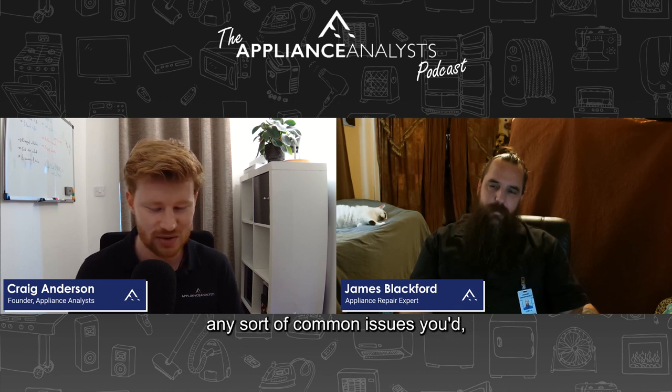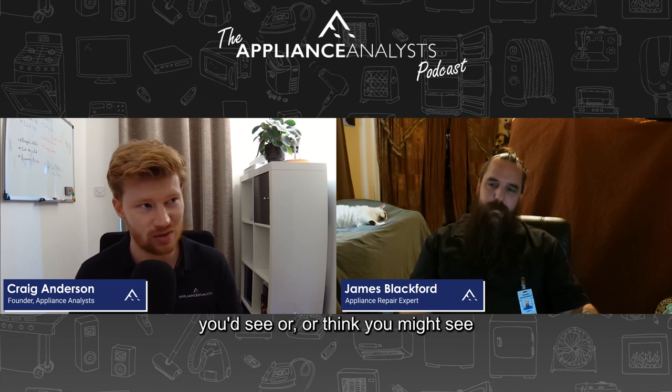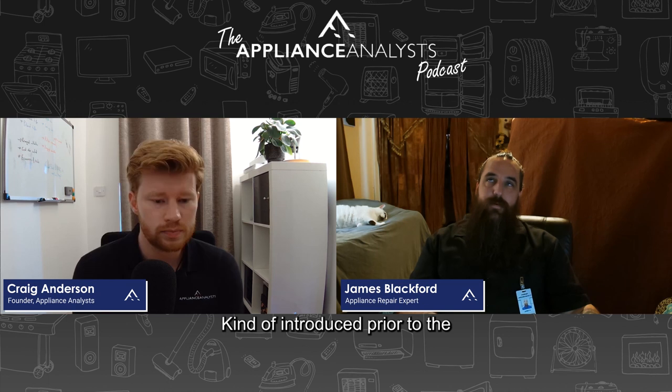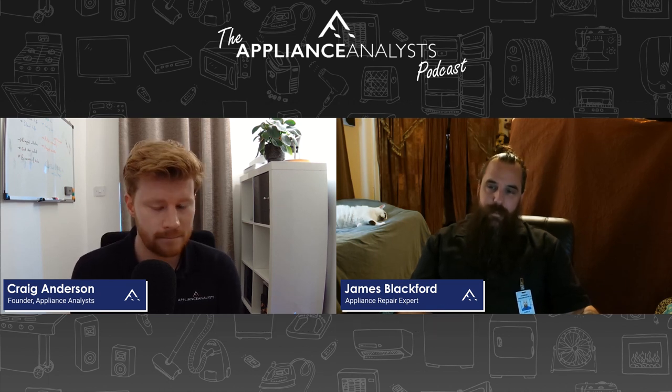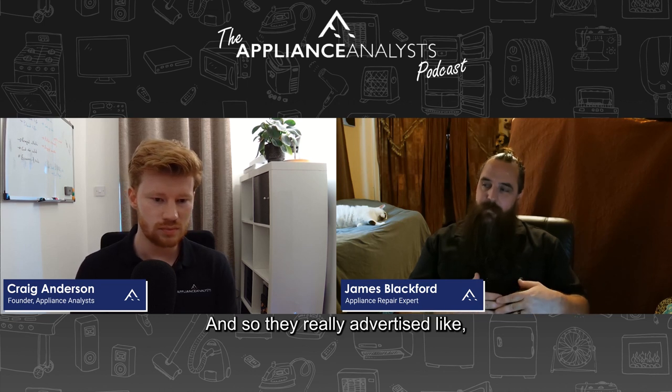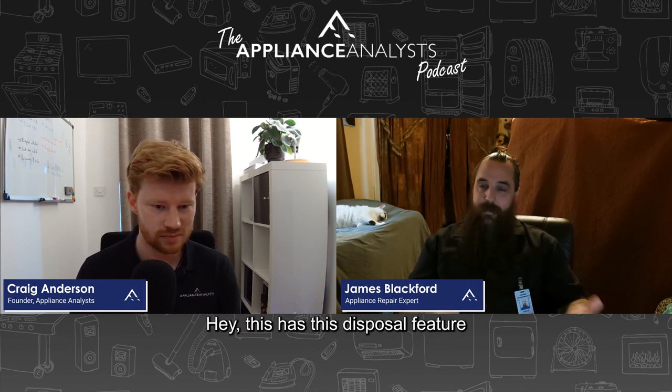Are those common? I'm just curious because we've done a few articles about them, and if there's any common issues you'd see or think you might see with them. That type of feature was really introduced prior to the dishwashers that have a removable filter. So prior to that, there was really nothing the water was passing through before it would get around to the wash pump assembly. And so they really advertised, hey, this has this disposal feature.